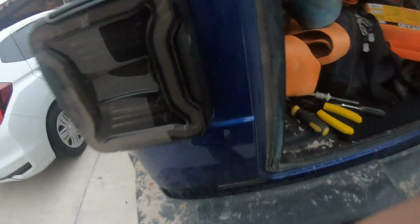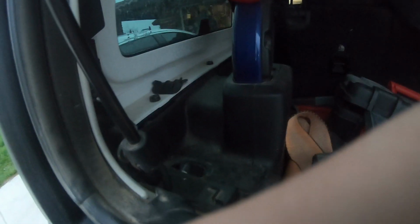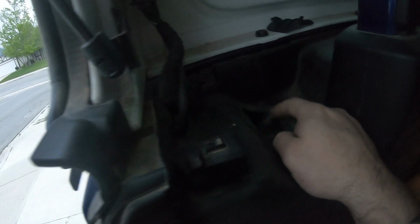All right, so after you have this piece screwed to the back of the taillights, all you have to do is put them back in. You can see you have here 2 little tabs, one here, and that little lip right there. So that's how it goes in. Just line up everything, and normally get this side in first, and then these will align and push it in. Make sure, there it goes. Everything looks nice and flush. Now you bring this little guy and you screw it back in from here. So let me get this started. All right, after screwing this one all the way in, make sure you don't overtighten this one, just snug, because these are plastic, you don't want to break them. So then put this piece back in place.